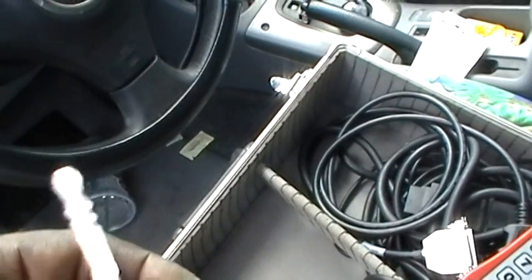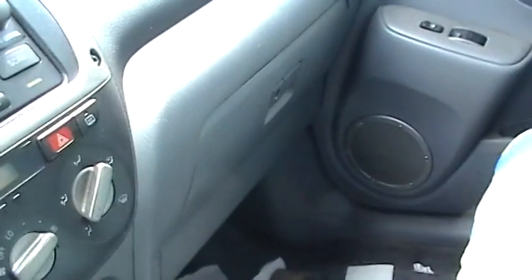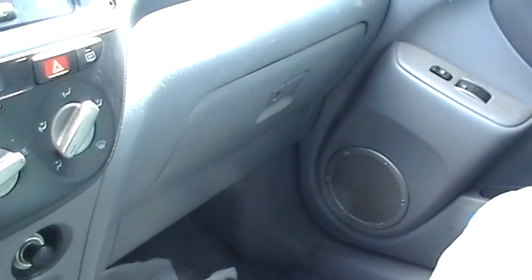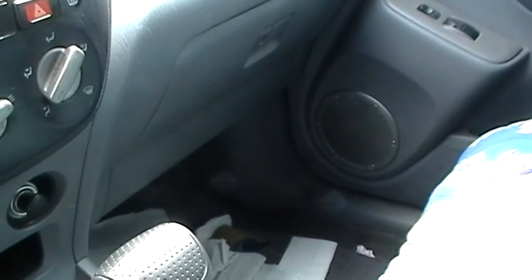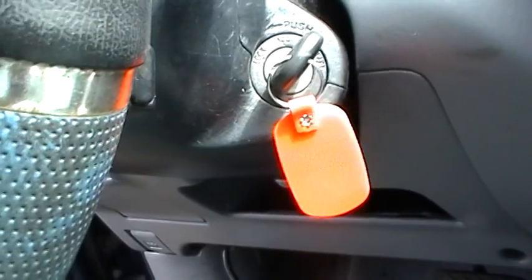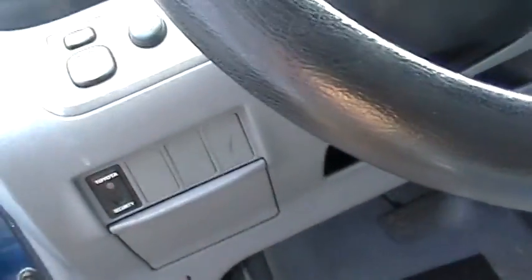What the publications say is that you take the ECU out, which is from behind this glove compartment here, and you can reflash that. However, on these cars up to about 2005, if they do have a transponder, they're not using the regular Denso ECU. So what you do — if it's not using a Denso ECU — you use a type 1 system and you program or reflash the ECU as a type 1 using the OBD connector. We selected a type 1 system.